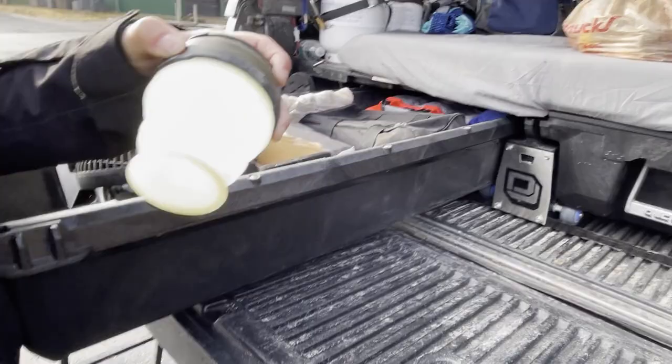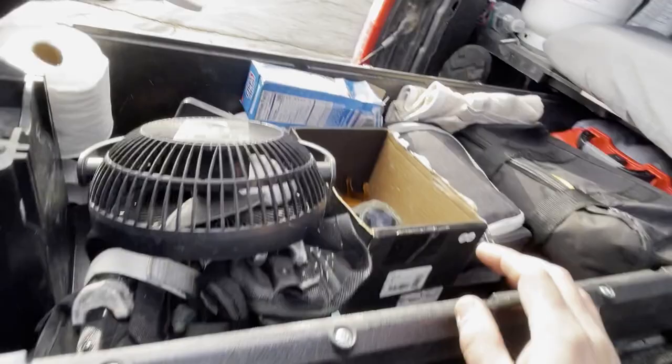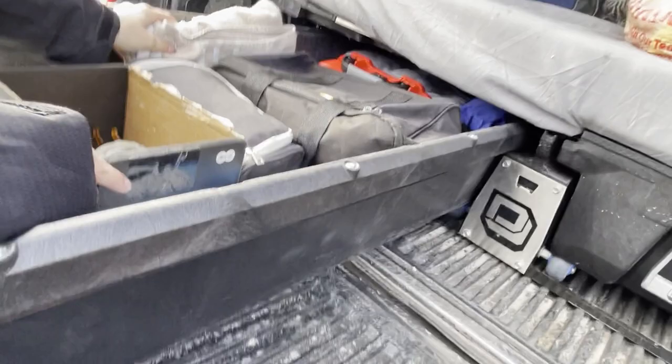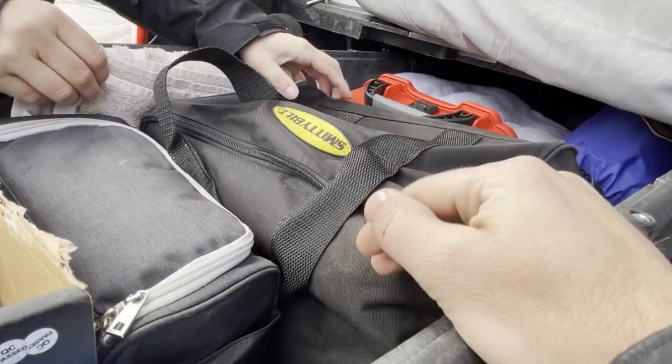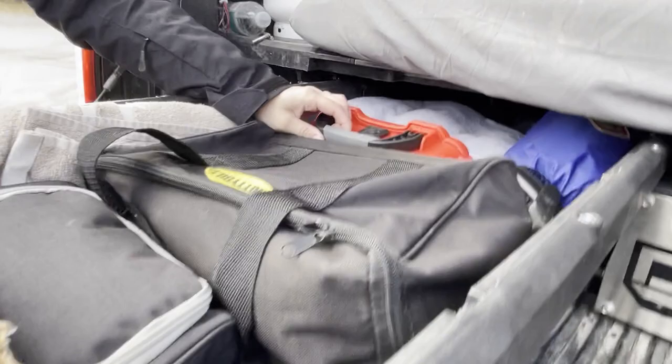We have an extra little lamp we stick on the table for card games, or hook it up when cooking on a picnic table with the Blackstone. Extra towels in here. Here's our whole air-up/air-down kit - we have speed bleeders. You set them to a pressure, screw them into the valve, pull a little thing out and it airs down to that pressure. Takes about five minutes per tire to air down and six minutes per tire to air up - going from about 25 pounds back up to 55 pounds.